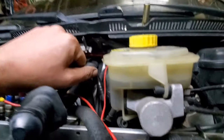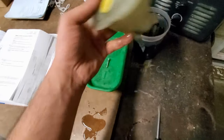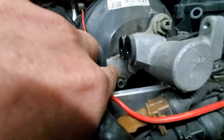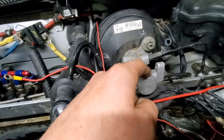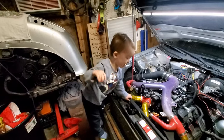I'm going to do that because I'm not going to be able to do it one-handed. We got that off. So here's the boot, here's the brake cylinder — it's leaking — here is the brake reservoir. Finally got it! So that came off. That's that little tab I was telling you about, right there. If you look down here, right there is that little ear — you'll have to get it over that. So if you're ever going to change your brake reservoir or need to change your brake master cylinder, this is a good DIY for this also.